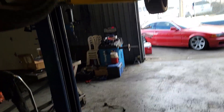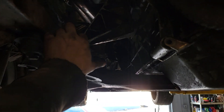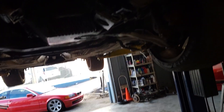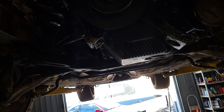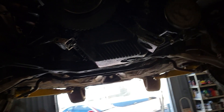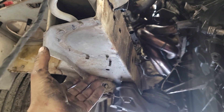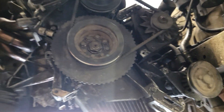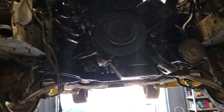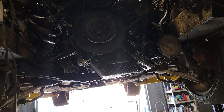Just buttoning things up — I just threw the ground on and I'm about to put the engine mount nuts on. Power steering pump we can do real quick before we go down with it. What I wanted to show you guys is how we've been doing the turbo setup. If you haven't watched our old videos, there used to be a lower support brace that went from here over — you can see it's spot welded in a few places with nothing bolted to it, just some plastic flaps to direct air through the radiator. We always knock that out when we do these turbo ones, and the intercoolers we buy — like a cheap eBay kit — end up fitting perfectly with this angle right here.